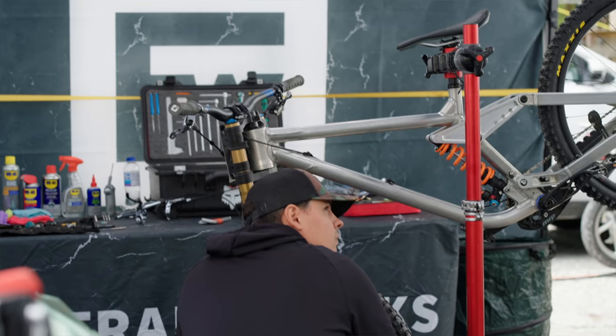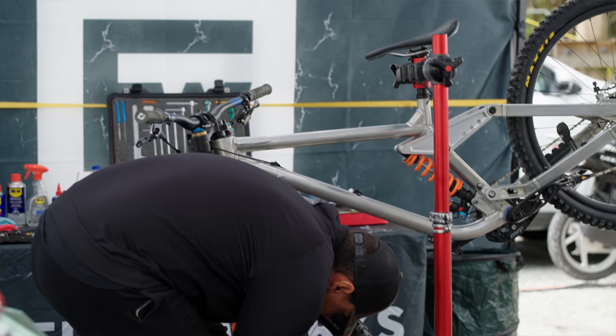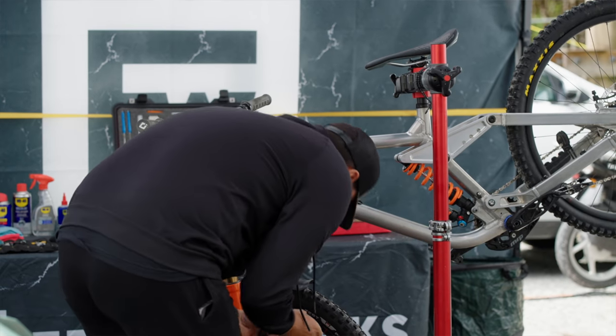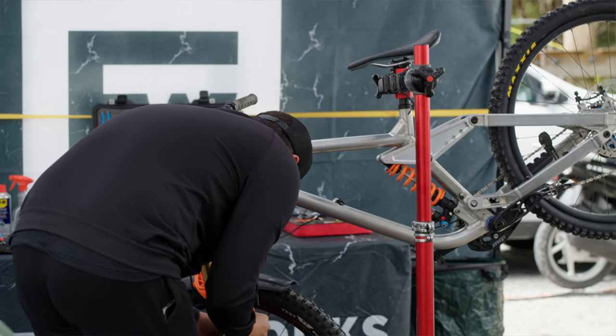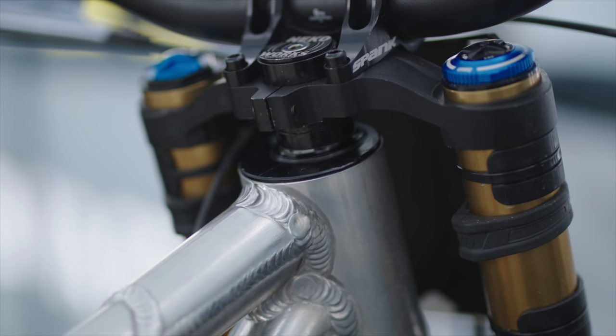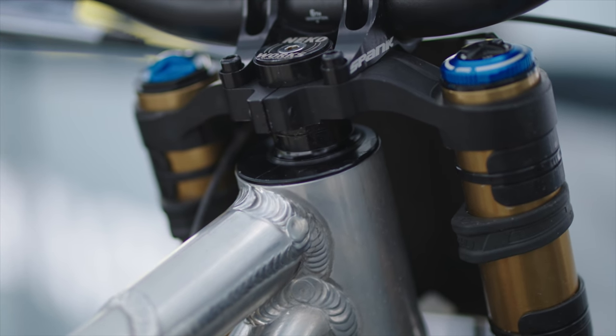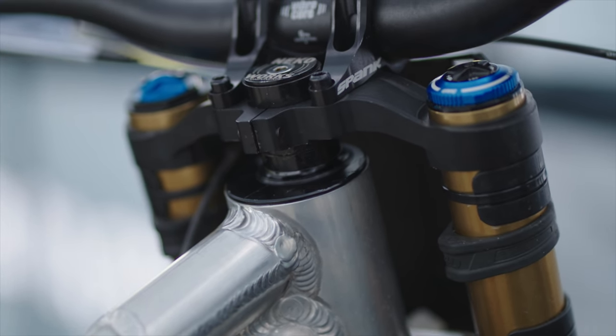I'm on version 3 of my frame and I've been super happy with it. The kinematics and geometry are all what I was hoping for, and now I just want to get some time on it and tune it in with minor tweaks. I went for a plus-6 offset headset, so I'm running a 486 reach now, which gives me a little bit more room. I rode Luca's bike one day and thought the reach felt pretty good being longer, so I threw a headset in and got a few more mil of reach out of mine.